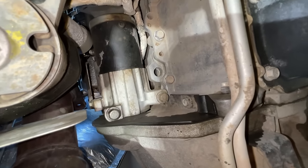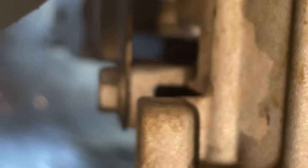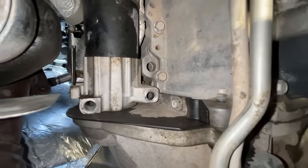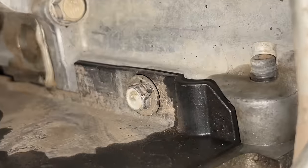We took a laser level when we knew the crank was at top dead center and made our own marks on it since GM doesn't seem to have any marks on their timing cover — completely optional but helpful. Next we're removing the starter from underneath the vehicle — make sure the battery is disconnected, there's still power going to the starter otherwise. There are just two 13mm bolts going straight up into the starter, and 10mm bolts for the little heat shield and dust shield on the transmission. Take those off and slide the starter right out.